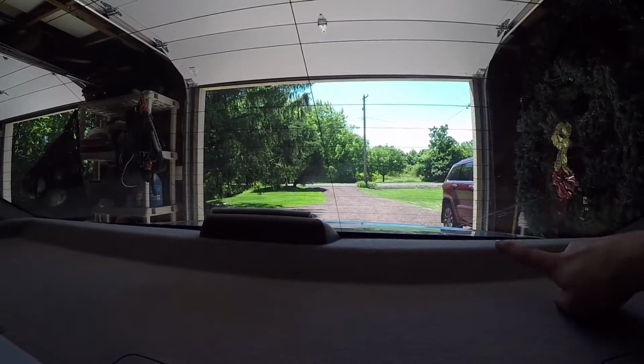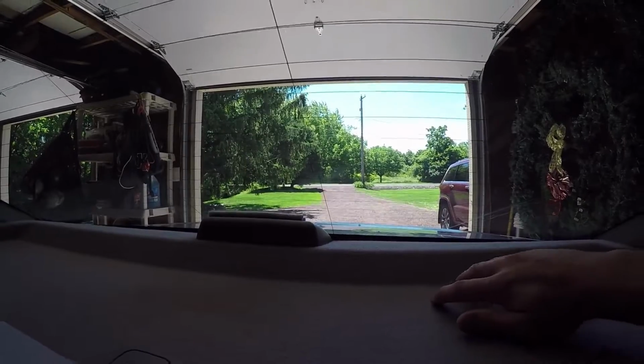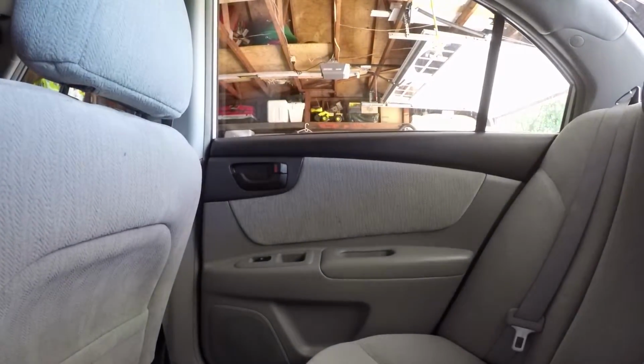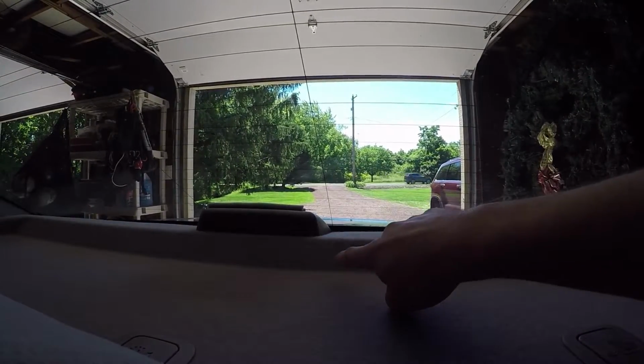I think from the rear here, I've lost almost all my rattles. Anything else is probably coming from any sound dampening I missed in the trunk, because I either couldn't access it through the narrow crevices in the metal framing, or it's coming from the cheap doors of my 08 Optima here. So I hope the solution can help you out if you're struggling to find any solutions online with the rear deck and third brake light.